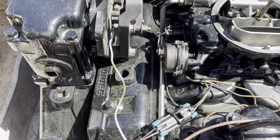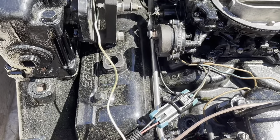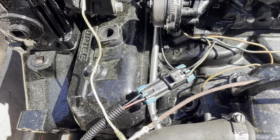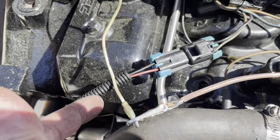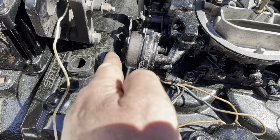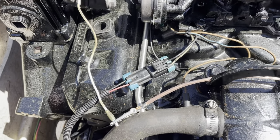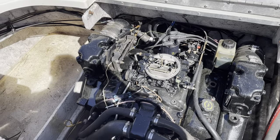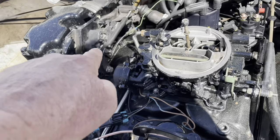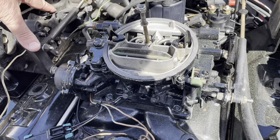This particular boat has an electric choke, and for whatever reason it's not connected. I'm going to reconnect it using a waterproof splicing connector. For now I've got this wire hot-wired back to the battery with an alligator clip — I want to show you how the shift kill works. With the engine running, I have a 12-volt jumper in here for the time being — I'll fix that later. Right now I've got 12 volts on this wire going to your shift kill switch, and the other side of the switch goes to your trigger. All I have to do is push this lever down to simulate a shift, and it will kill the engine.